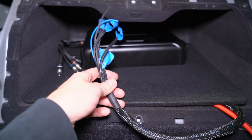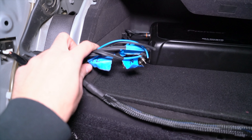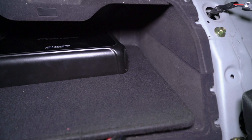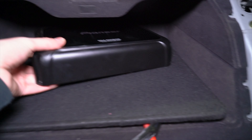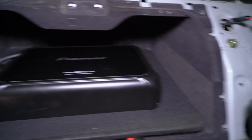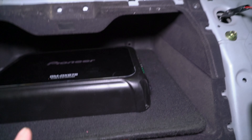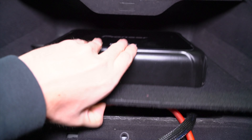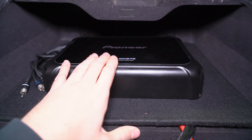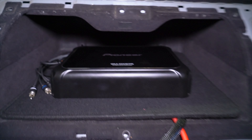One of my limiting factors is the speaker wire — I did a 12-and-a-half foot run, and if I oriented it on this side I think it would just reach. But to allow myself a little bit of slack, we're going to mount the amplifier this way: RCAs are going to come in on the left side, power and speaker wires are going to come in on the right side. I'm going to get this mounted to this plate and then work on getting our wiring to come through the sides in a super clean way.